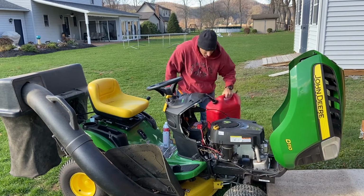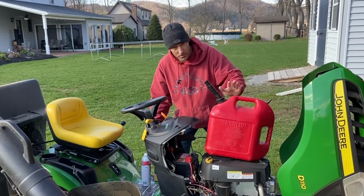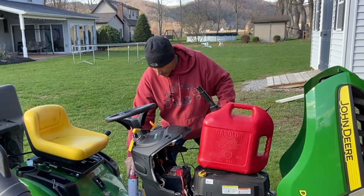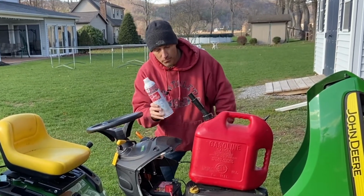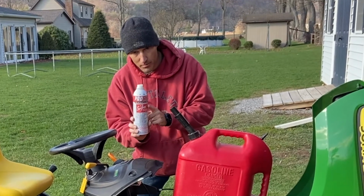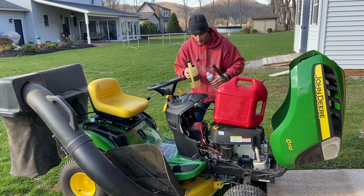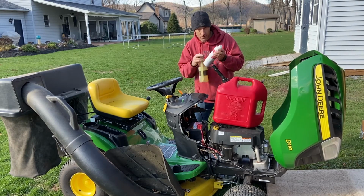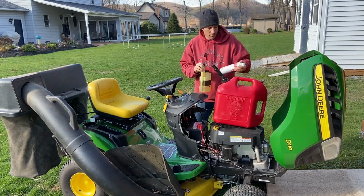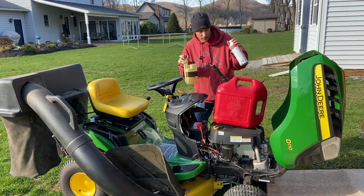And also, if you have gas and you're not going to use a lot over the winter, you might want to put a stabilizer in your fuel. I like to use Sea Foam. You can use this Sea Foam for a lot of stuff, but it works really good for a stabilizer. I saved one of my old containers and I just put my Sea Foam in there. I'm going to put some of this stuff down in the description in case you want to check it out and read some of the people's comments about it.